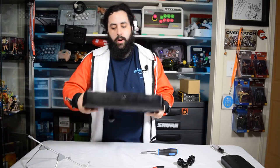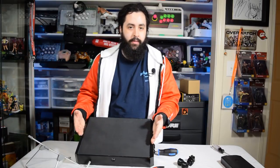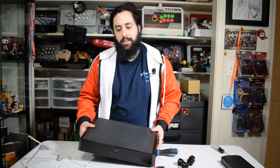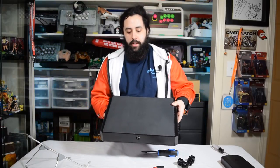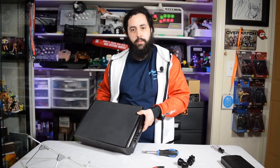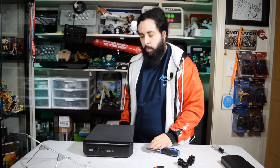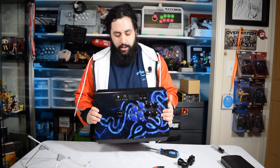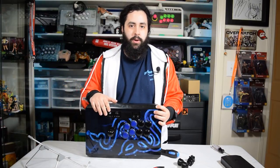The stick does kind of get in the way. You can lean it like that, and sometimes it'll stay like this. Sometimes the weight of the back plate, because it's usually solid metal, will cause an imbalance and it starts to tip over like this. What I do a lot of the time when stick modding is do it on my lap. That way the stick can just rest between the legs or off to the side. It's not laying on something uneven, or if you really want to try it, you can put it on the edge of a table. But the easiest way would be to remove the stick. That way it's just laying flat and you can get to the internals, pull all the quick disconnects out, and switch the buttons and everything.